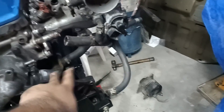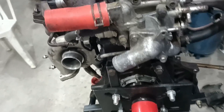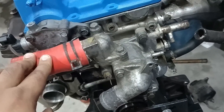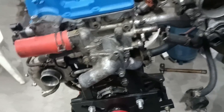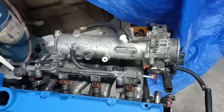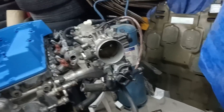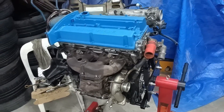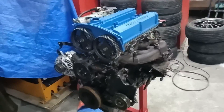We made sure to use the 4G63 cooling equipment — water pump and the coolant hose going to the thermostat cover — which just makes things easier on the plumbing side. The reason we retained the 4G63 head is to keep using this setup; otherwise we could have run a Sonata valve cover but we did not. You can see these are the EVO 4 intake manifold, injectors, and throttle body — EVO 4 stuff with no changes there, which will also work on the Sonata head. Progress is still ongoing — we're taking our time to not make any mistakes.